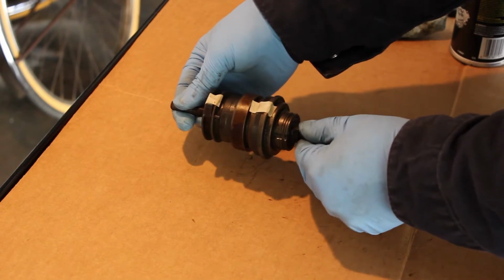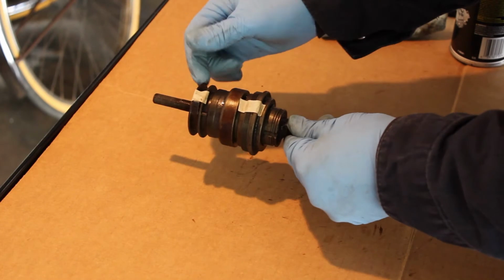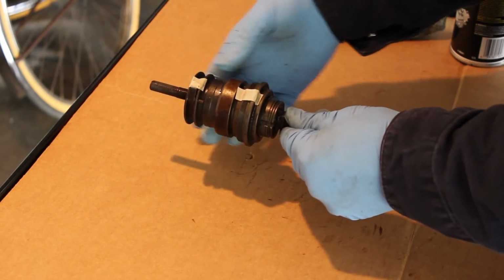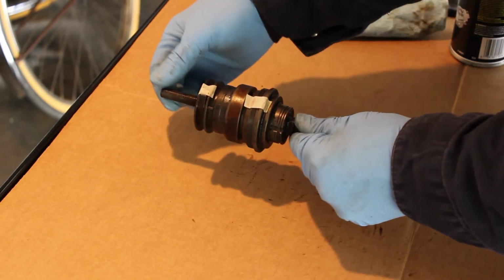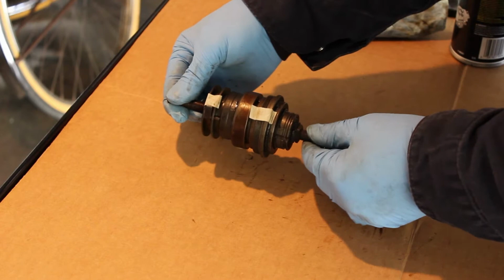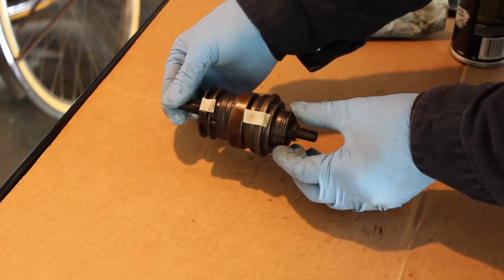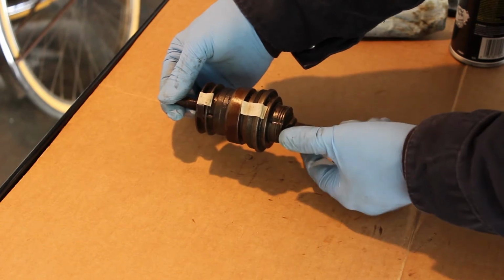So right now it's stuck in third gear. The drive right now is connected to the planetary gear cage, this section over here. Over here is the ring gear, and inside here is the planetary gears. The axle stays fixed, so I'm going to make one full turn with the drive hub. So that would be right here